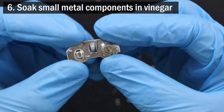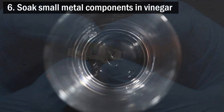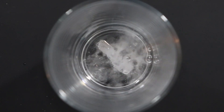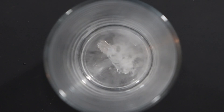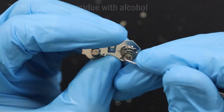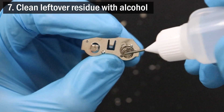Moving on to the battery contacts, clean them with vinegar and IPA as well. I actually had soaked these terminals in vinegar to neutralize the battery leakage first, so you see me doing that here. There's a lot of battery leakage that got onto these terminals, so this reaction is going to be going on for a little while. After that's done, I pull it out and I lightly scrape away what's left and clean up the rest with IPA.